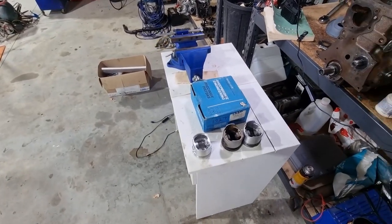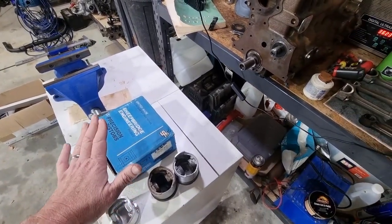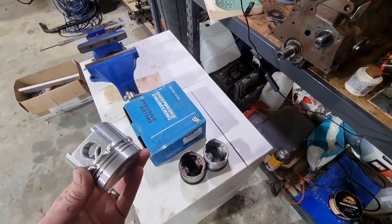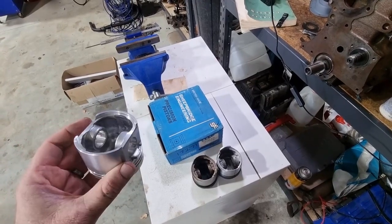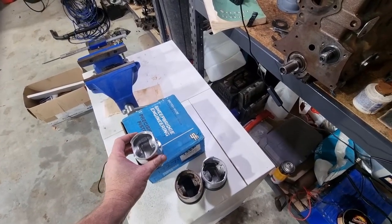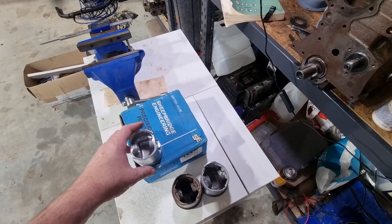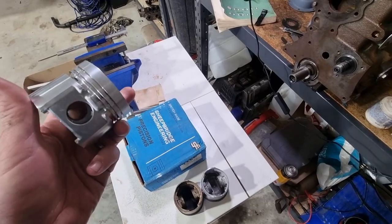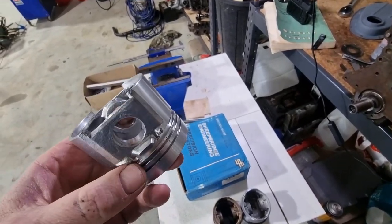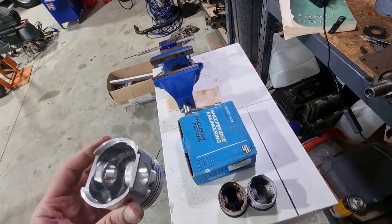In my last video I mentioned I was waiting on parts for the Mini — they've arrived. They're a new set of pistons. Why do I need a new set? I had four perfectly good ones; I now only have three as a result of a failed attempt to install the wrist pin. I was very carefully heating up the small end of the conrod and unfortunately only got part of the way through before it cooled. I had to press the pin back out, and as a result caused pretty solid damage to the piston — screwed up the race basically. That's that for that set.